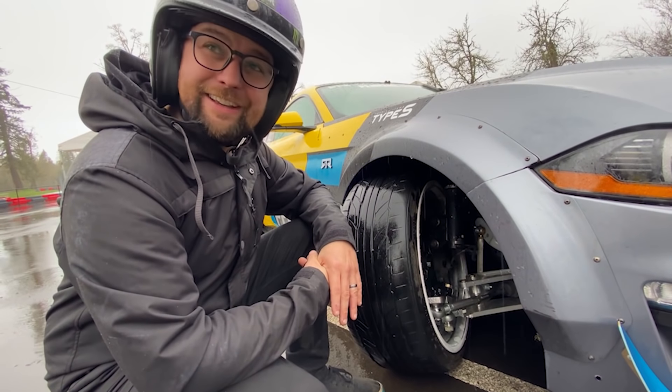I'm really thrilled on it - I missed my alignment by a little bit on the wheel, but it's got gobs of angle and a lot more steering feel than it ever did. It's still a heavy car with electric steering, so there's those things, but it's much much more driftable now. This has a spool in it and we run 255/35s in the front and 285/40s in the rear. It doesn't really push in drift, just a little around normal driving because of the spool, but the front grip's pretty good - I wish it was dry.